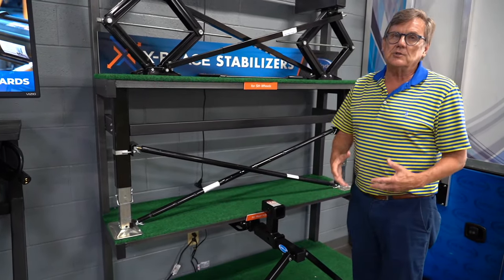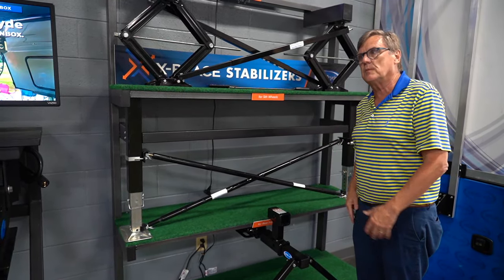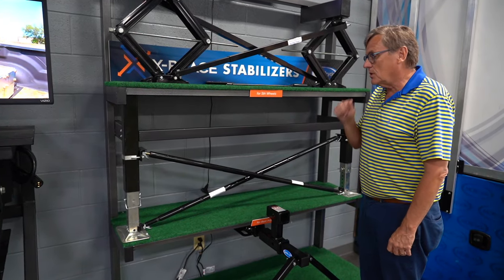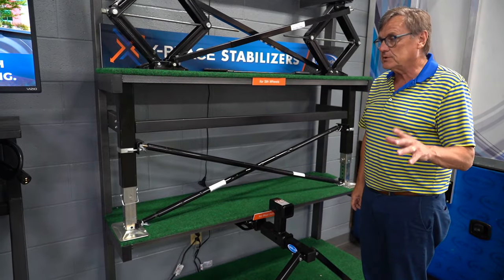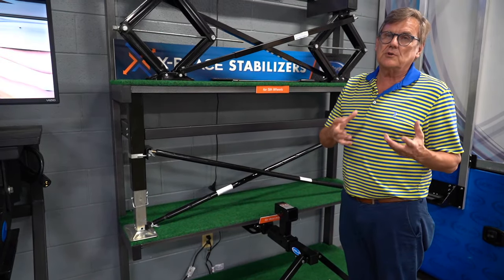Well, there's a lot of hydraulic leveling jacks out there, especially on really nice fifth wheels. And so those people said, well, what about us? We have the same problem where we feel that unwanted movement, and the 6-point leveling just isn't able to cover that. So, brand new product. As a matter of fact, on Tom's unit, it's the first prototype. And it takes basically this front design and only puts it onto the hydraulic landing legs.